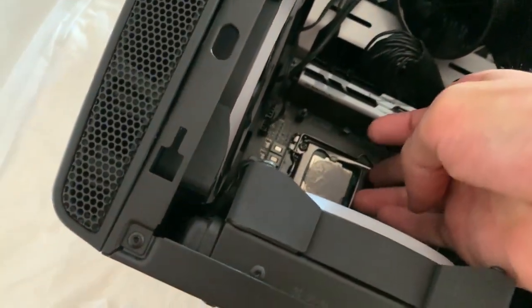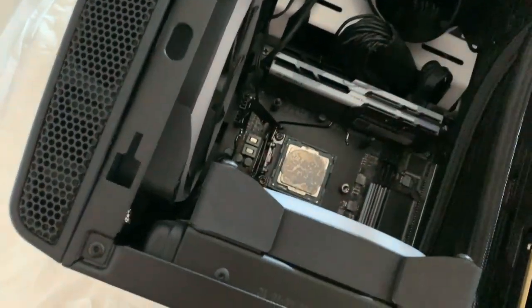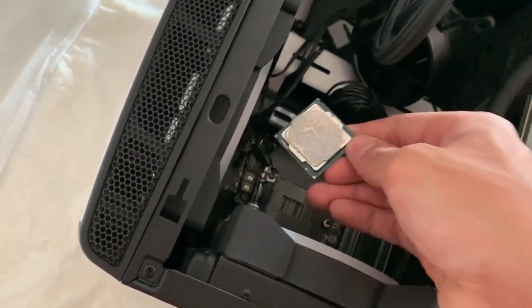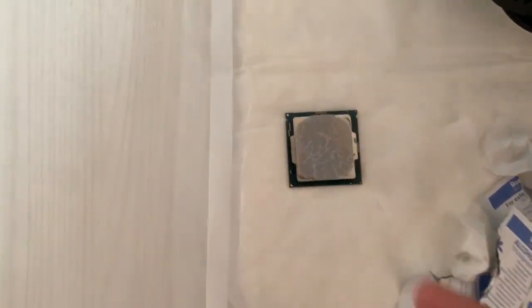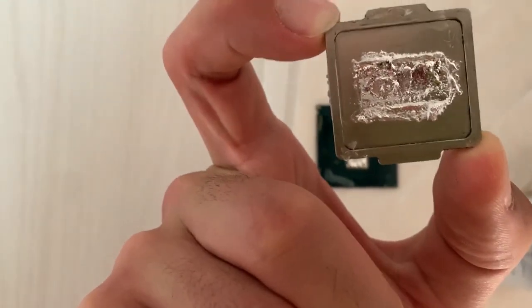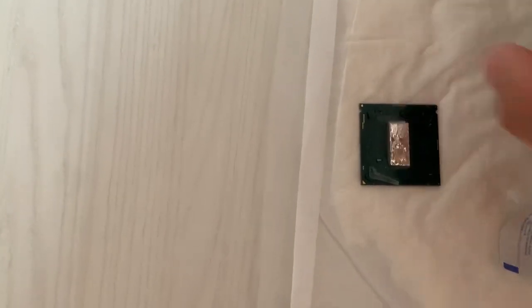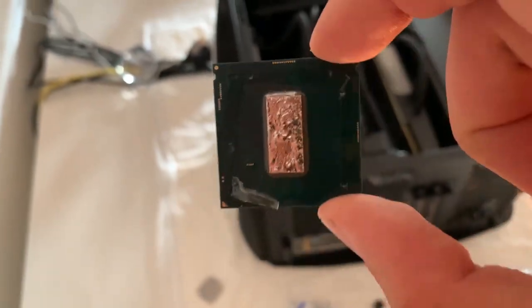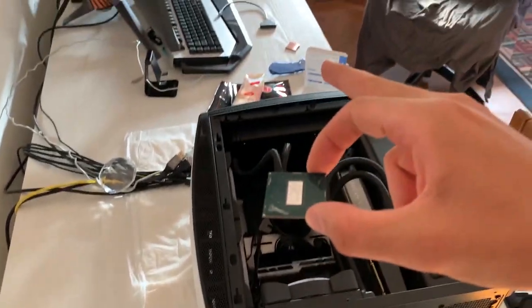The socket is pretty much open, and that is because I did not remove the S-TIM from the die, so it didn't really fit. I had to use some nail polish to actually make it close. Let me just grab the CPU and show it to you properly. It's kind of closed because of the nail polish, but I'll still be able to open it up pretty easily. As you can see, the S-TIM was used with the die, and now we're gonna clean this up and apply our copper IHS.